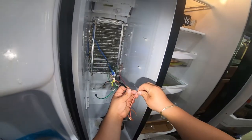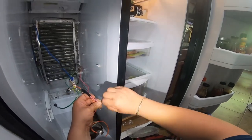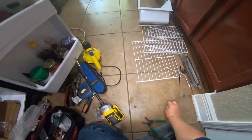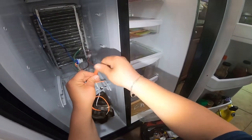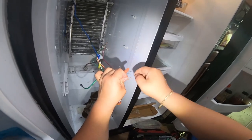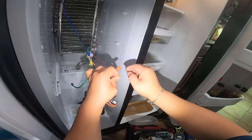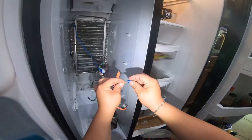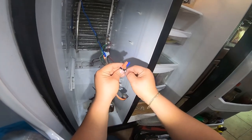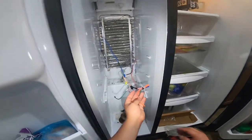Sometimes you might find the heat element is still good but the defrost thermostat is bad. So yes, if you see ice there, follow this video and do this repair yourself if you have the knowledge. You can use orange wire nuts as well — they're a little too big but still work. The best size is the blue one. Twist the wires together first by themselves, then twist them together for a better grip connection. Put the wire nut on and then add another zip tie to secure the wires together so they don't come loose from the wire nut.